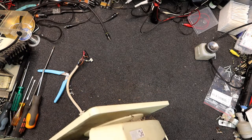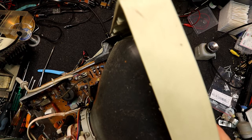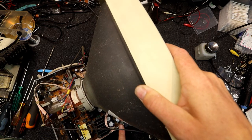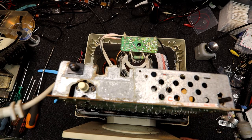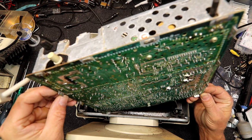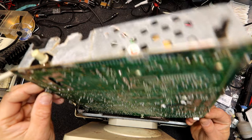So there's nothing really super low voltage as you'd expect with a 5-volt rail. Unfortunately I haven't labelled the connector that went to the computer. There are quite a few trim pots down the front here, none of them labelled, which is pretty annoying. I don't know whether Orion made these whole boards. No labels on the connector on the underside either, which is annoying — it would be nice if they labelled the 5 and 12 volts.